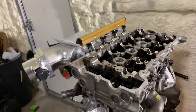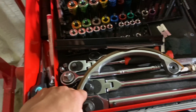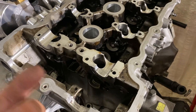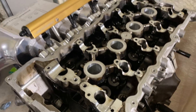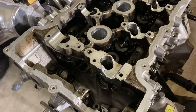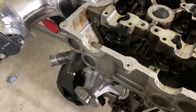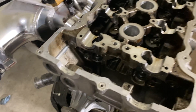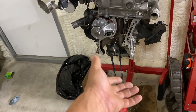The head is now torqued. We used the Harbor Freight torque wrench - this thing's been used a couple of times and I've used it to tap something off or torque a wheel, but never for anything major like torquing a head. I'm going to bring a Snap-on torque wrench during the week to go over each stud one at a time and check it. The nuts made some weird sounds tightening down, probably because I don't have ARP head stud fastener lube on them.